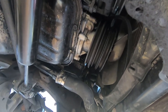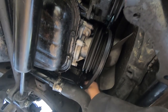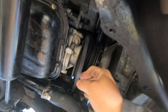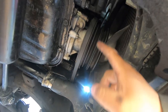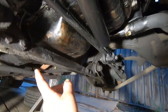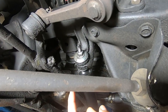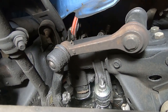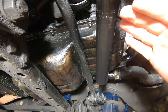Now I think we're going to put all the serpentine belts back on and then we'll get to the oil pan. I'm not going to show every single step — basically do everything you undid. We're going to start with the alternator, put the serpentine belt on and get that tight, then move over to the power steering pump, and then the AC belt last. To remove the oil pan we have to remove this bar right here and we have to remove the stabilizer. I don't know if we're going to knock this out from the pitman arm or remove it so all this could drop and we have some space to remove the oil pan.